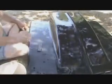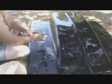Okay, now what I'm going to do is keep sanding with this Meguiar's. They say to sand in one direction. Basically when I do this, I'm bearing down in one direction and dragging it back. Everybody has their own way. But what I'm doing is lifting it down and I'm staying a full inch away from this bevel here. I don't want to get anywhere near this with the bumper because I've already learned you touch that edge, you burn through. So I'm giving it plenty of leeway. On this edge here, I'll come up to within about a half inch of it.